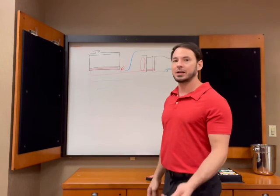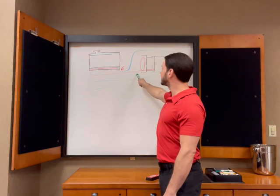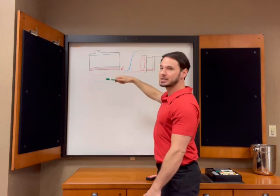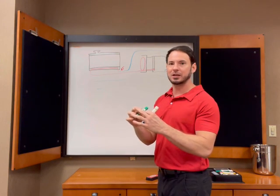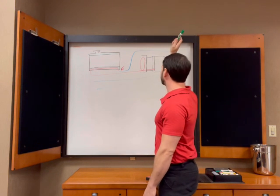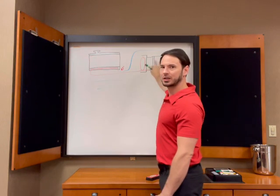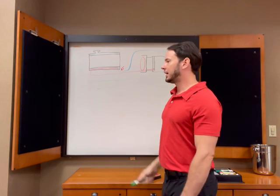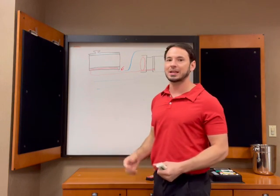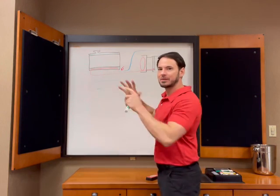What happens when they do that? You keep on driving it like that, you start seeing 300 degrees across here, the torque converter turns black and blue. Like I said, you blow the seal out of here because the rubber seal melts and seizes the torque converter, tears up the bushing, starts blowing fluid out of the vents, your fluid aerates, destroys your pump, and your transmission's toast. I have not personally seen one this bad, but one of the Subaru guys that I worked with told me that he has seen them on the Loyales so bad that you can't even disassemble it.